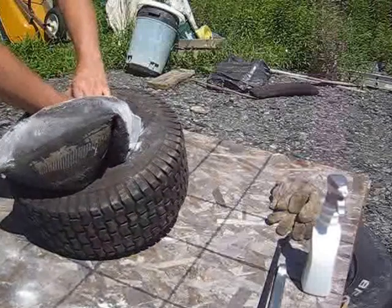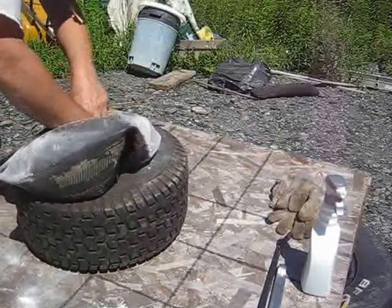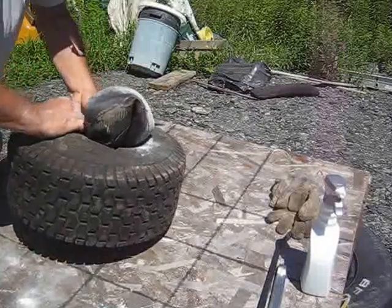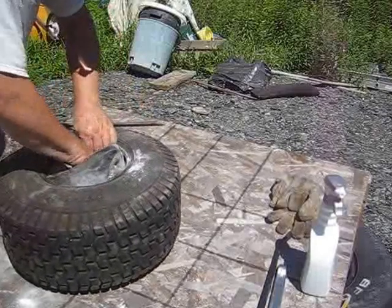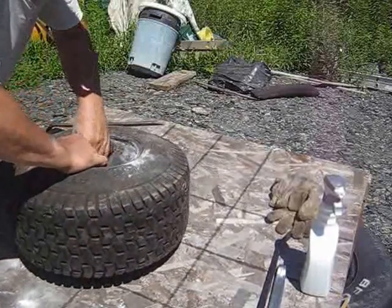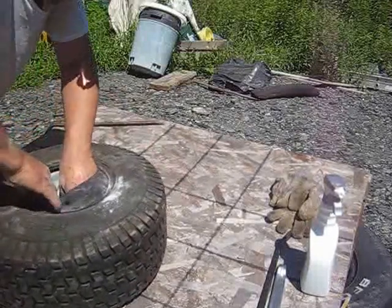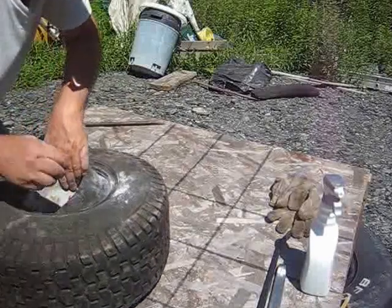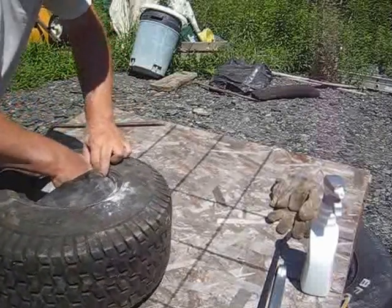This takes a little doing. It's easier to do on the floor than on the workbench — on the floor, when you're putting the tire back on the rim, you have a little more leverage. This tube is stretched out because it's been used; when they come out of the box they're a little tighter. I didn't mention earlier — you want to check the rim to make sure it doesn't have any sharp edges from when you took the tire off using your pry bars, because something really small could go right through that tube or wear through it and give you another hole.